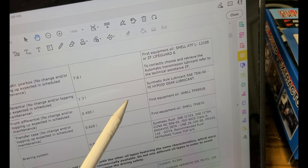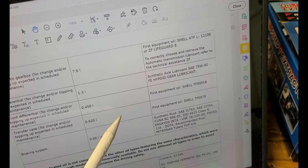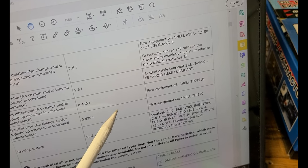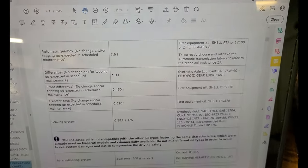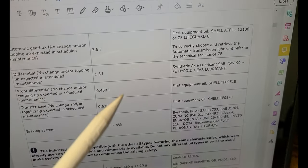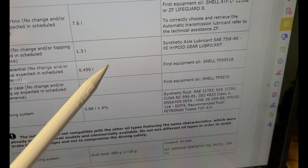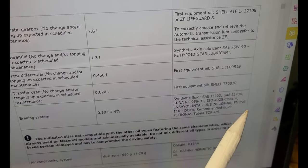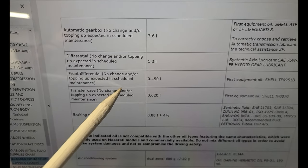Same for this. When I put this in, I have more than enough to pump all of this out to clear all of this stuff out, so there won't be any contamination. In other words, using the next fluid to clean out the previous fluid from the pump. The bottle I can clean manually, but that's my plan. So we're going to start off with the differential first.